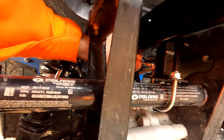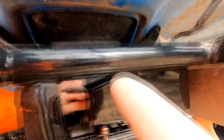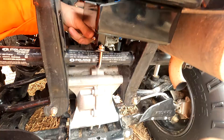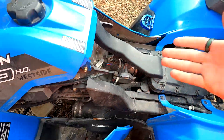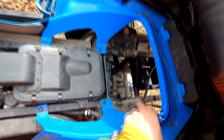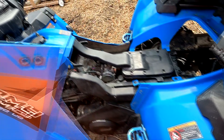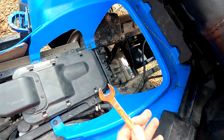One benefit of having it out — you don't have to do this. It's almost the right size. You see where this lip is? You could almost just cut a square in the bottom of the box that's supposed to exist here, install this anyway, and just silicone the crap out of it — because then your battery is fully protected. I'm going to get this tightened down and then we'll move on. I just went ahead and took the seat off — you just grab the seat from the back, pull up, pull forward, and she just hinges off. It's easier to run the wire along here in the body, especially if you take this panel off — it's just a couple of pull pins, you pull those pins out and she pops right off. I came in through the back to undo that other bolt because it was just easier than reaching through the frame.